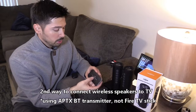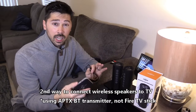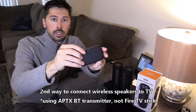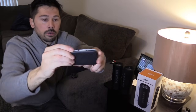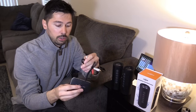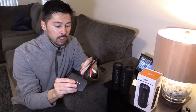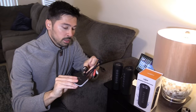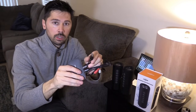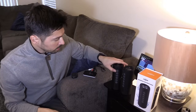So we're going to get started. I want to use this device as a Bluetooth transmitter from my TV to the speakers. We're going to plug it into the transmit port, which is the red port you see right here. Now it does have a built-in battery, so I don't have to have it plugged into my TV's USB port unless I want it always powered on. If you want it always powered on, just plug it into your TV's USB port or a USB adapter. Press and hold the button in the center — that'll start to blink. It's in transmit mode, blinking really fast.